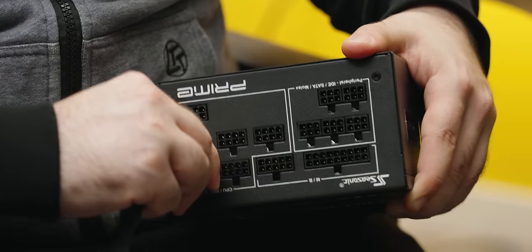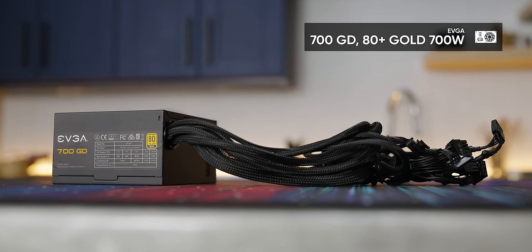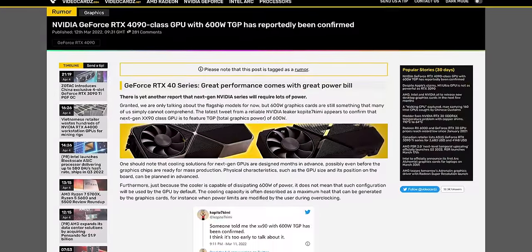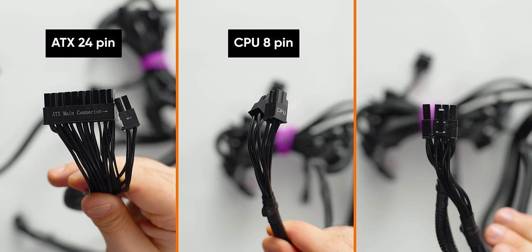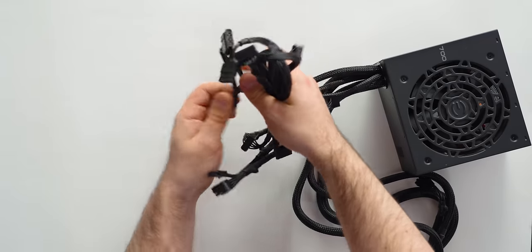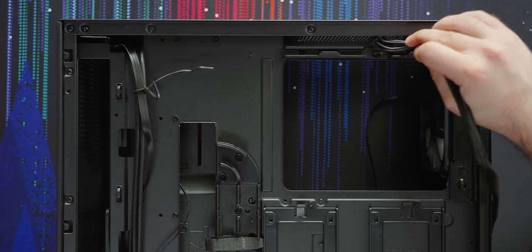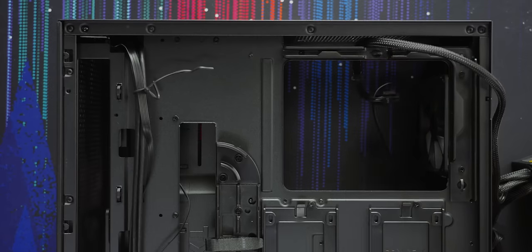So much room for activities! We're going to do this in a weird order, but you'll thank me later — starting with our power supply. Fully modular power supplies are a super cool upgrade for experienced builders, but while it's hard to put cables in the wrong way, it's not impossible and it does add extra steps. So we went with an EVGA 700 GD, rated for 80 Plus Gold efficiency, outputting a bit more juice than we need today with some to spare for the reportedly power-hungry upcoming RTX 4000 series. Let's grab the only three cables we actually need: the ATX 24-pin, CPU 8-pin, and PCIe 8-pin. Bundle the extras — SATA, Molex, and extra PCIe cables — together and forget about them for now. Put your power supply close to your case, then take the 8-pin CPU cable and feed it through the cutout at the top. Give yourself as much slack as possible — we're going to clean that up later.